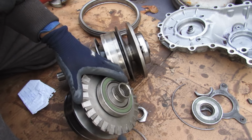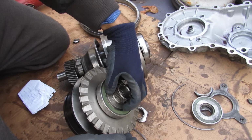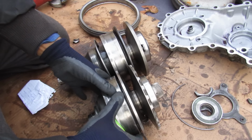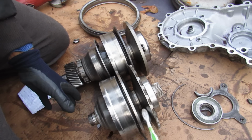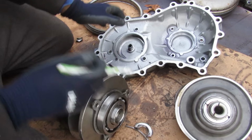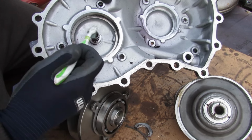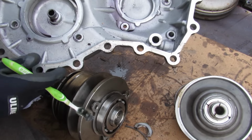Now the hydraulics on the input shaft come in through this part of the shaft over here where the planetary gear set actually butts up to. Oil pressure is then going to enter inside of here and fill up this chamber over here, which is going to slide this back over here, reducing the effective diameter over here. Now on the output side variator, hydraulic pressure is going to enter in through here, and it does that through the transmission casing where it has this port over here that feeds it directly. That actually leads up to this port over here, which goes back into the valve body of the transmission.